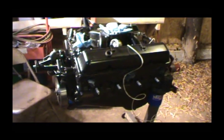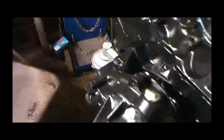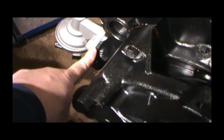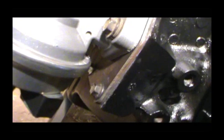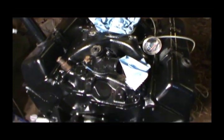Welcome back to the shop. Today we're gonna get some oil primed up. Got the oil filter on, got the pan filled, went ahead and put the fuel pump on. I didn't put a gasket in between here because I wanted to set this cover plate on. Pretty much got the block painted and I finished painting the heads yesterday. Got some new grommets, all the plugs are in — they're just hand tight for now.